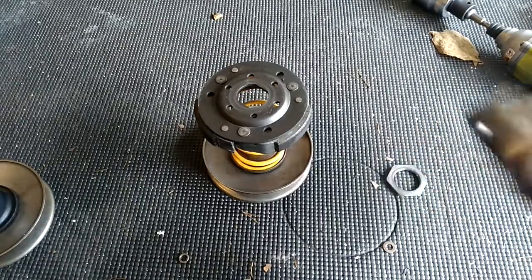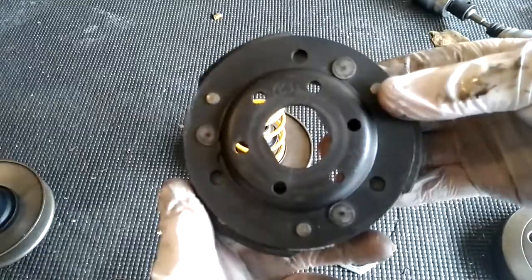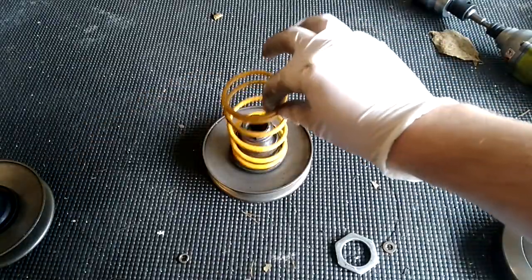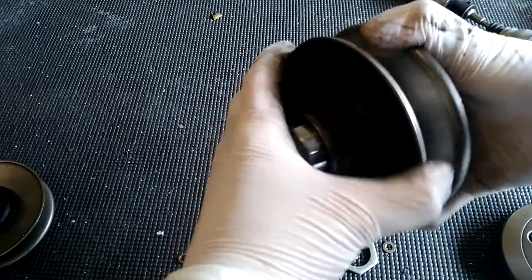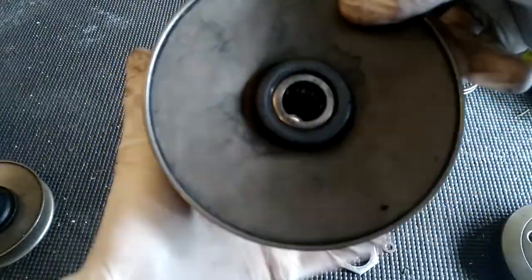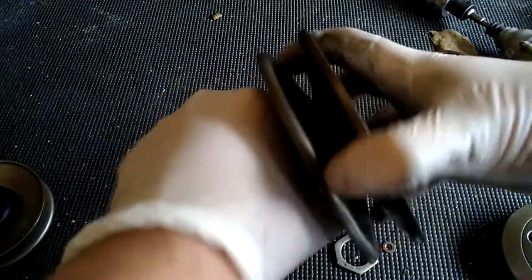Basically we're left with a couple parts. This part of the clutch — the clutch bell — just comes off. This is the nut. This has the pads. We're going to be changing this one for this one right here, which is basically the same thing. Now here's the actual spring — this tight spring didn't really do it for me, so we're going to be switching it out. The most important part of the clutch is what they call a torque driver. You should be hearing what sounds like weird noises coming from this when you turn it, because there's actually a bunch of goop and lube in these ramps. You should be feeling a little bit of resistance — what you don't want to feel is a grinding feeling or something like that.